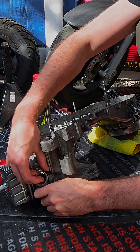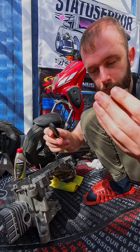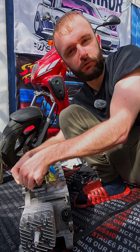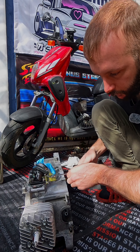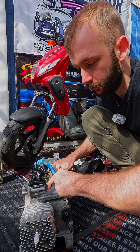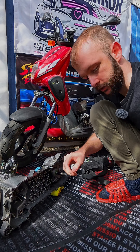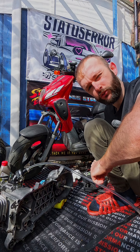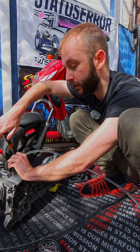The first thing I'm going to do is just make sure that the piston is at bottom dead center — and that's bottom dead center right there. Now we can put this rubber bung and metal block over the exhaust port and clamp it down. When I applied Honda bond and tightened everything up really tight straight away, it didn't seal — it took me two or three attempts last year. So now I just tighten everything loosely and then the next day tighten it nice and tight against the Honda bond. We've got the spark plug in, the exhaust blocked, the piston at bottom dead center. We just stick this gauge into the end here, pump it up to 6 psi, and wait 30 minutes. If the gauge goes down we've got air leaks. If there are no air leaks, the engine can go back in the bike today.